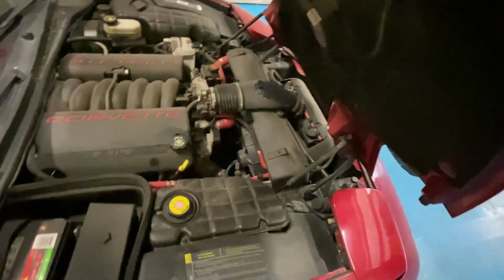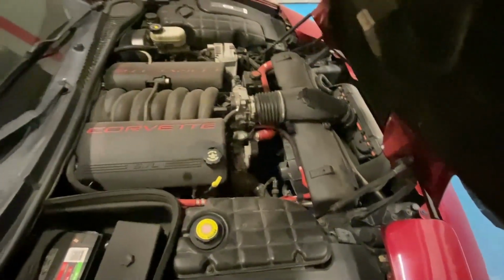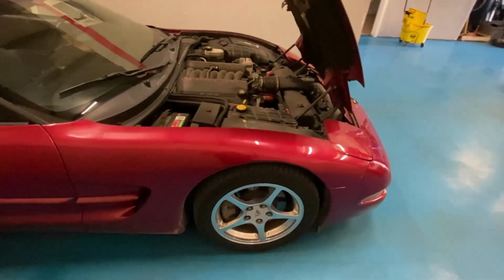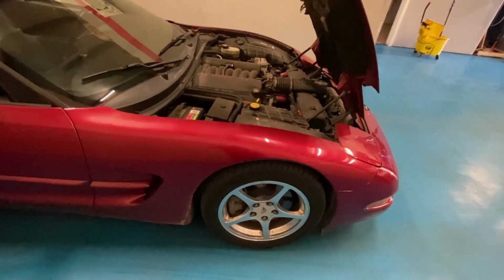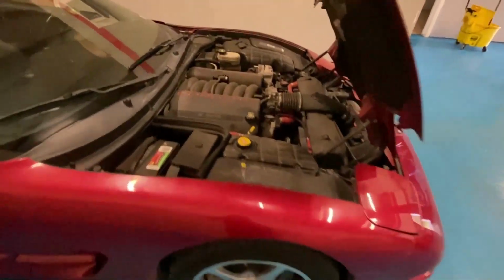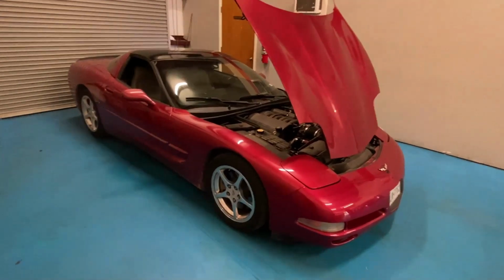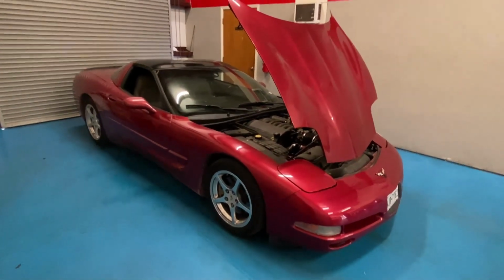Unfortunately, these cars have a really tight space between the balancer and the rack and pinion, so a cam swap requires the rack and pinion to come out and up out of the way to clear the balancer, to take the timing cover off, to take the cam out. So we're gonna get into all that while we're there. It's an old car, so we're not gonna do a cam without lifters. We're gonna go ahead and do lifters, lifter trays, head gaskets, head bolts, so he starts fresh and we don't get any ticks, no knocks or anything like that.